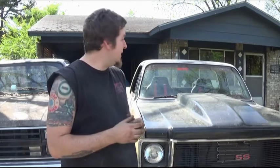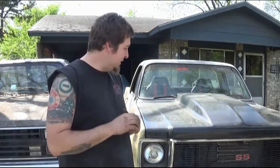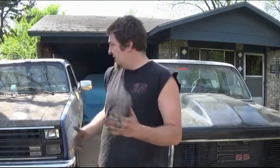The better alternative to get a cooler air intake fuel temperature is to, one, probably like this, a cowl induction, and then find some way to cool down your gas. That's kind of old school, but it worked. So that's what I'll stick to. But there it is. Honestly, in my opinion, unless you're full out drag racing, save your money, get the non-air gap. You'll probably be happier with the non-air gap anyway in the winter time.